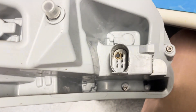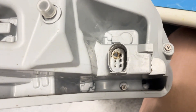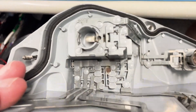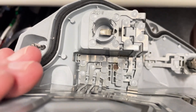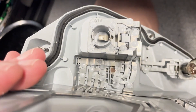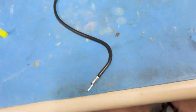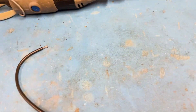As you can see, there's a hole left where the plastic is burnt, and the terminal that was in there was still electrically connected — it was corroded or burnt at the front but still connected at the back. What I've done is used a Dremel to cut through the remainder of the bus bar, just using a regular Dremel bit like that.